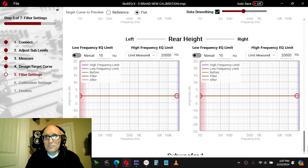As long as nothing's clipping in anything you're playing, you should be completely fine with that. So Windows multimedia device output, HDMI audio pass through enabled. A default should be able to pick up the device you're actually playing it through, but I can force my Denon, right? I just can force this to play through there. So, you know, I'll save that as well. Where are we? All right. So, timing. Let's see if this works.